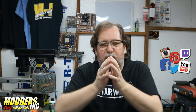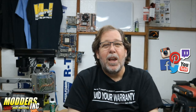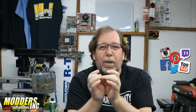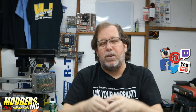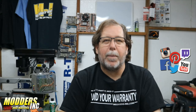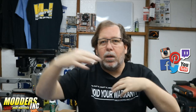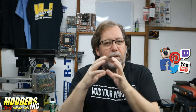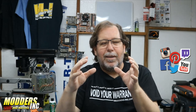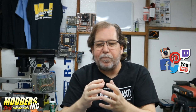If you notice, some of the other ones just kind of oozed over the sides. You don't want to do that. I would rather have a little less than way too much, because you don't want to get it all over the CPU and all over the sides, because who knows what might happen. But I think most of them, you can see, covered most of the CPU no matter what. There were a few that were a little short on the corners, but as we all know, most of the heat is actually in the center.